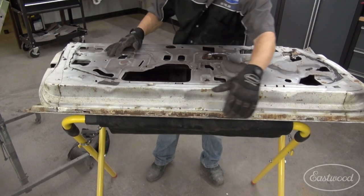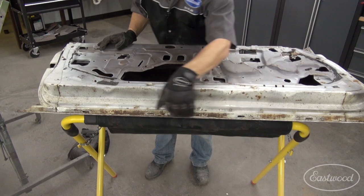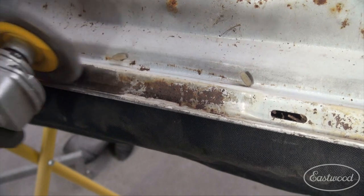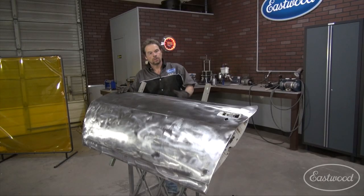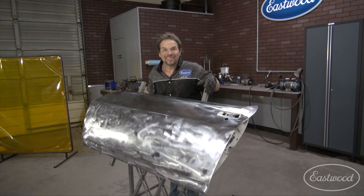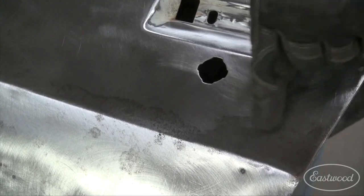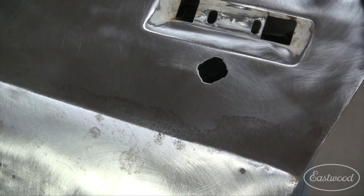If you look, for the most part everything is good - the sealer's still intact, the door skin is not rusty. A little bit of surface rust here, but that's just an easy thing to prep. Throw a little fast etch on there and we'll deal with the rest when it's time to paint. Okay, so the door is naked - it's stripped beautifully and quickly. But we're not ready for any kind of a primer, and here's why. See that pitted rust in there? The stripper's not going to get that. Sandpaper's not going to get that. Even those beautiful cleaning discs aren't going to get that, so we can either media blast that with something ultra-fine, or we can chemically change that and get it ready for the next step.